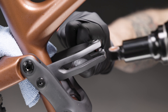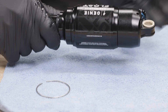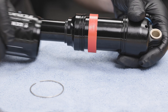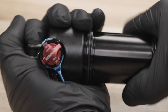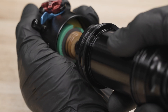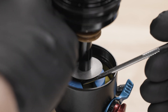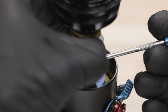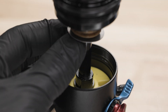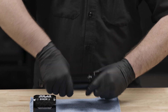Push the outer sleeve up and away from the retaining ring. Remove the retaining ring. Remove the outer sleeve. The two-part red spacers click together, fitting around the shaft. To access the eyelet spacer in the secondary chamber, unthread the inner sleeve and slide it downwards. Slide the bumper and supporting washer away to expose the eyelet spacer. Change or remove the eyelet spacer. Re-thread the inner sleeve. Add back any volume spacers you plan to run in the outer chamber.